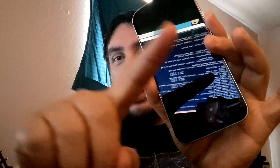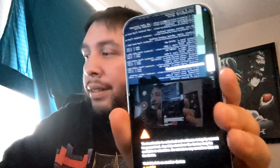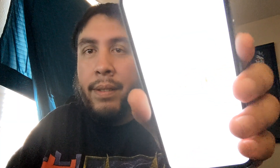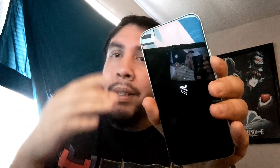We're still in recovery, so hit 'Reboot System Now' and disconnect the USB cable. You can see the terminal and all the commands in the reflection. This is the initial boot — you'll see the Evolution X boot-up animation. This video is just about installing the custom ROM. I need to set everything up and make sure everything is working; if there's any hiccup I'll do a wipe and reflash. Check out the next video — I'll link it in the description — which will be the full first impressions of Evolution X 11.